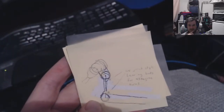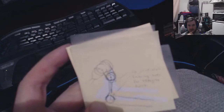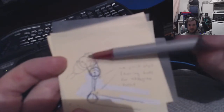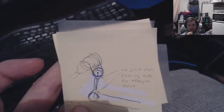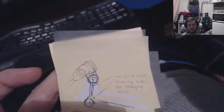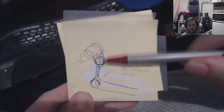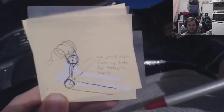So that is the key, and that's the part I was missing when I was just creating the prototype in my head using videos. I wasn't visualizing how much crap is in the way and just how high up the differential is. I didn't realize it's like knee height compared to the driver. So that all made a big impact. When I was learning about the differential, I was looking at a rear wheel drive differential, and that's way below the driver's. But a front wheel drive differential is up knee high almost, so that needed to be accounted for in the translation of a chain up here to a chain down, out, and back. And that's where we want it. So we're just moving everything out to here before we go back to the rear of the car, to where the motors are.